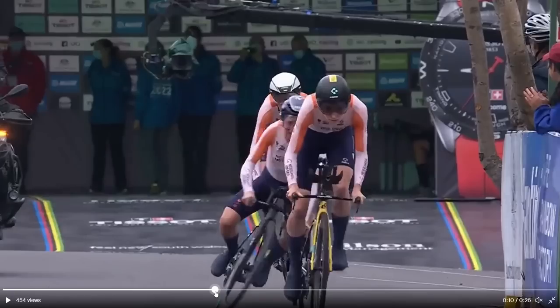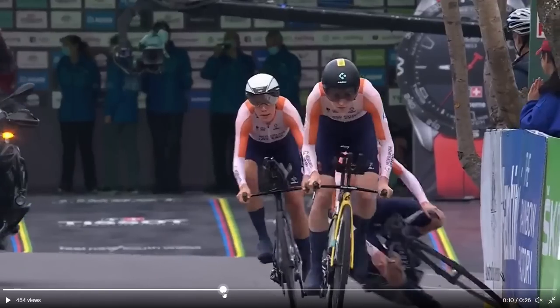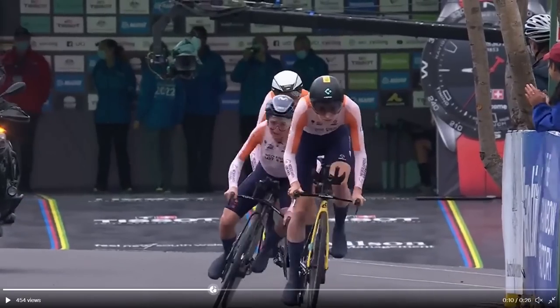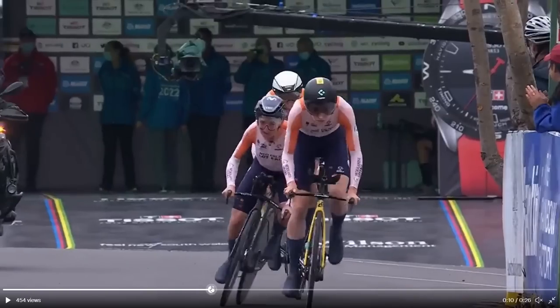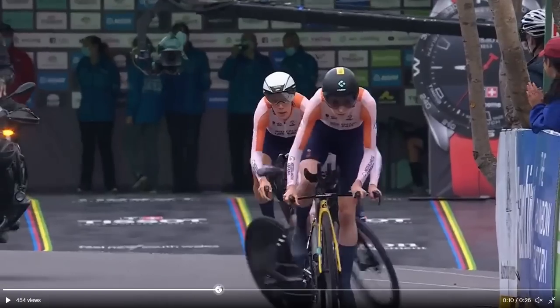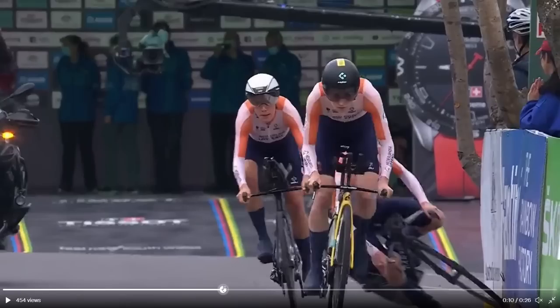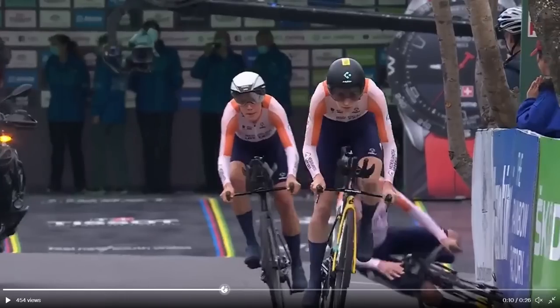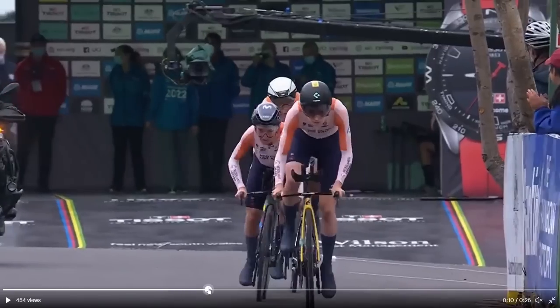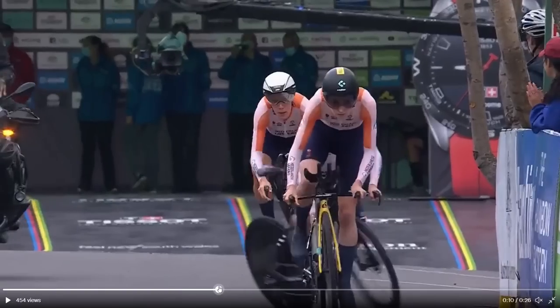This is the point I'm quite confused about, because you'd expect there to be sealant flying out and there isn't. I think that probably means the tyre just hadn't sealed properly on the rim. Because obviously if it was an explosion or a hole, then the sealant would fly out. But if it was more like it just wasn't seated properly on the rim at all and then suddenly had a massive loss of pressure, the sealant stays inside because it's just coming out the valve. That would make more sense - that's probably the explanation, but it could literally be that she had no sealant and it exploded.